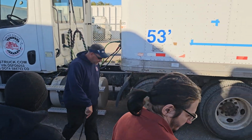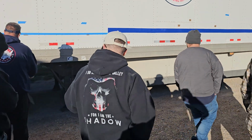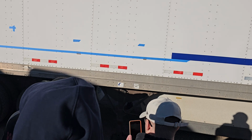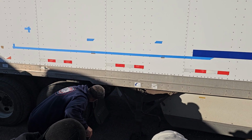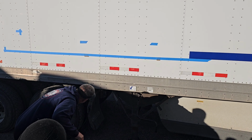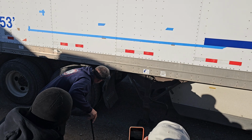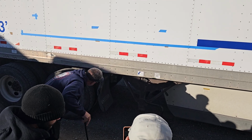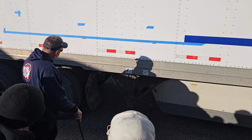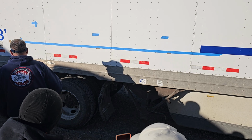Go to the rear of the truck. Alright, my DOT tape is present and not peeling. Okay, all my lights and reflectors back here are securely mounted. No cracks, no signs of moisture, the proper color red. The lights I would check back here would be my tail lights, my brake lights, my left turn, my right turn, and my four-way flashers. Lastly, back here is my mud flaps, splash guards, securely mounted, and they are not ripped, torn, or dragging. Here's the switches.